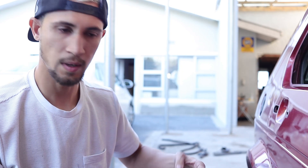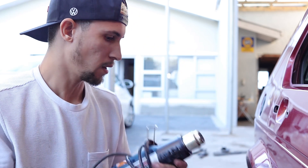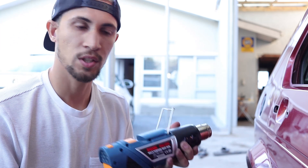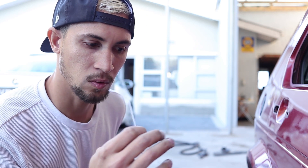If you know where I can get replacement clips and panels, leave a comment down below. Shout out to Wade for lending me the heat gun. I'm going to apply heat to the sticker, but you don't want to apply too much heat because it could damage the paint. Luckily we're painting the car, but if you're not, don't keep the gun too close. I'm also going to use a card — like a store card — to get under the sticker once it can be peeled off. Also make sure the surface is clean so you don't scratch the paint.